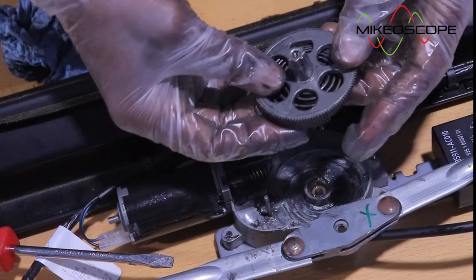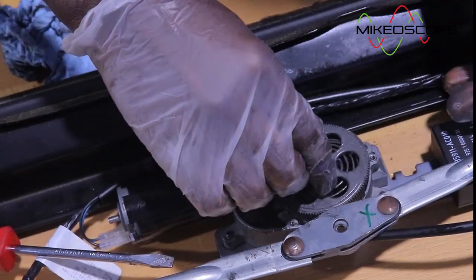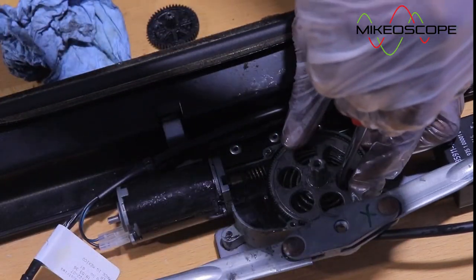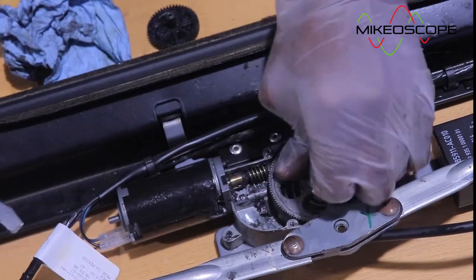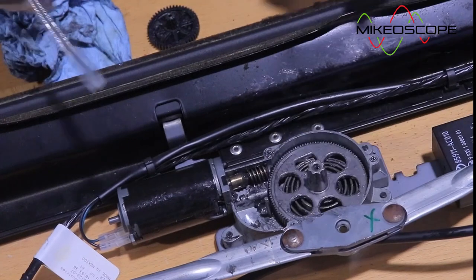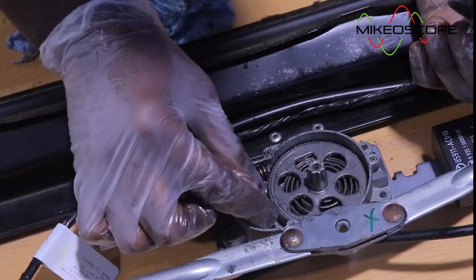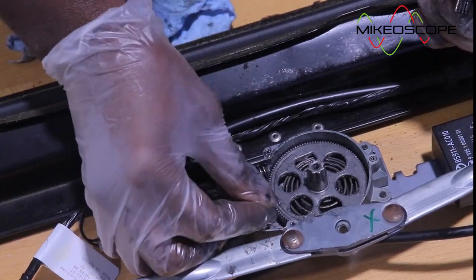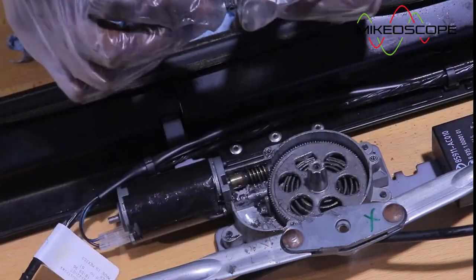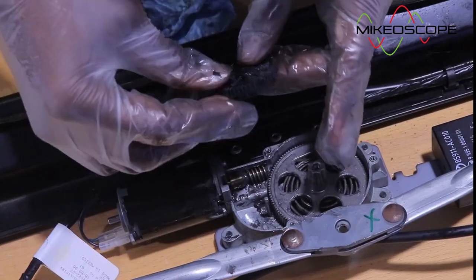And this piece here should lock right on this lip when this is in place, like so. Okay, like that. Okay, so that's locked up in there. All right, and there is this pin that sits in here. It's a small hole there that the pin sits in as a pivot. And this gear on the back of this plastic piece, okay, this plastic piece here, sits on this pin and it interacts with this gear that sits on the spiral torsion spring. So like so.